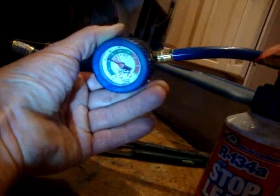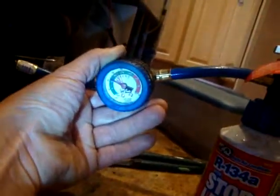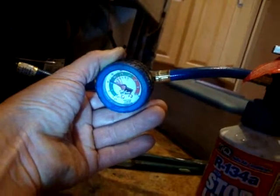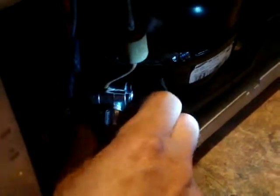It's probably just the design of this system, so we'll see what happens. There's still some stop leak left in the bottle — you can feel it, it's nice and icy cold, so the gas did go in. I closed the valve there. This stays permanently — you don't take it out. You can remove the little adapter if you want, because that's not necessary anymore. As long as you close the valve, you're okay. It comes with a little cap, so you can put that on — or leave the adapter on for future use. I'm just going to let it run. All I can do is wait.